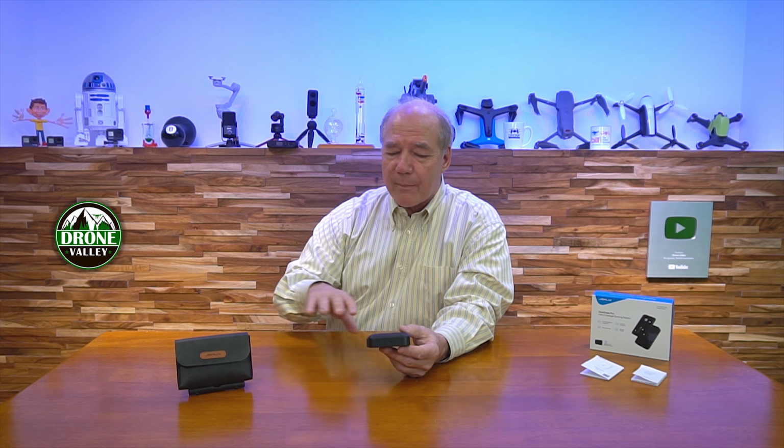I love the fact that there's a USB-C port in the end for an external power supply. And again, it's a PD compatible port. It'll handle up to 100 watts of external power. A lot of the hubs in the market offer an external port for power, but they limit you to 45 watts or 60 watts, which will charge your laptop, but it really won't provide a lot of external power for peripherals that you'll connect up. So up to 100 watts right there. And again, fully PD compatible.